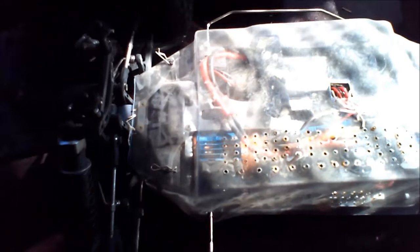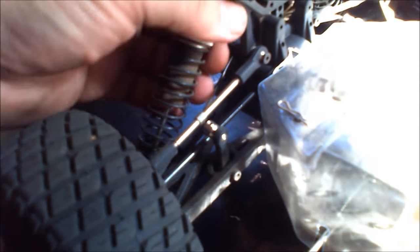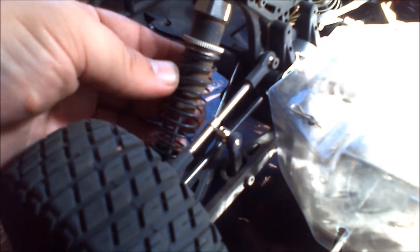So I just got back from my run. This is the IMEX Samurai. Like I was saying, these back suspension — they're overdamping a lot. They're fully adjustable — they've got upper and lower aluminum caps with threaded collars. They're plastic bodies, big bores. They're good shocks, they just need tuning. And it's not a big deal. I wouldn't be like 'these are garbage' — this is called tuning.